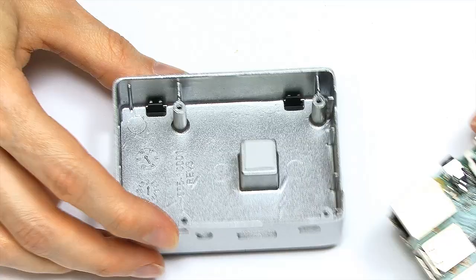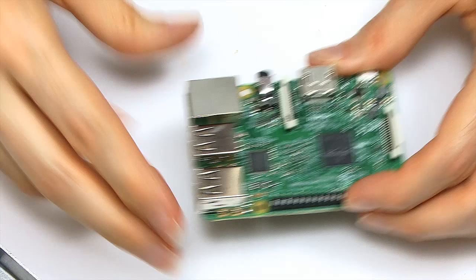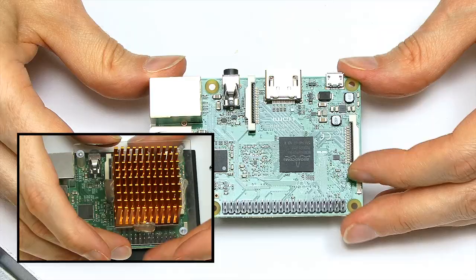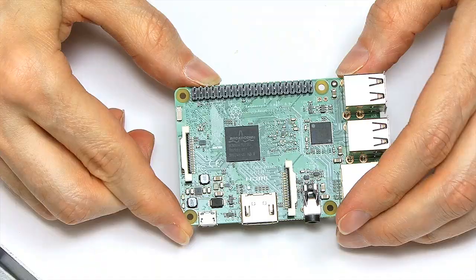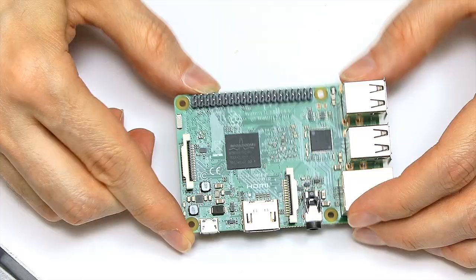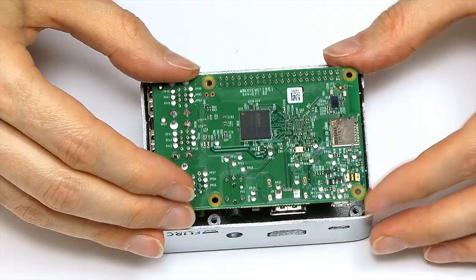You can use this case with a Raspberry Pi Model B+, a Pi 2, or a Pi 3. It's most useful for a Pi 2 or Pi 3 because of the integrated cooling system — it's a lump of metal. Here's my Pi 3. The large heat sink that was previously on it has come off cleanly because I used Arctic Silver 5 as the thermal paste rather than epoxy adhesive. It cleaned up very well, so I can now drop the Pi into the Kodi case with the processor contacting the heat pad.